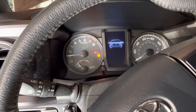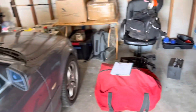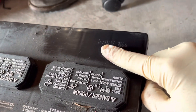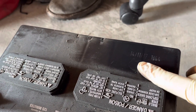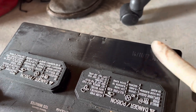We are good to go. One last note before we call this a wrap — you can see there's a date code stamped on the battery: 14-11-17. Sometimes they have the month and year stamped on the negative post, but this factory Toyota battery has its date code here. That means this battery is going on about 5 years old.